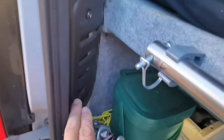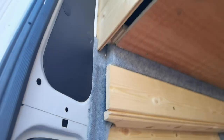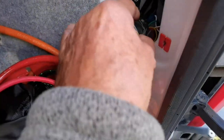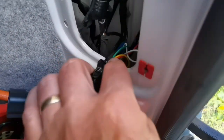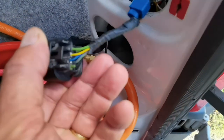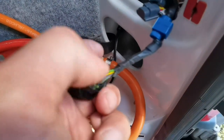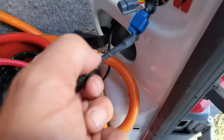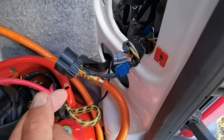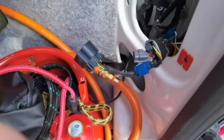What I did then was take a red wire - which you can see in there, I've not tightened them up yet - and it goes all the way over the top and down here, then plugs into the wiring loom here. You find out which wire it is, look at the color code on the back of the plug, and correspondingly put one of these blue clips on that wire, connect your towing hitch wire to that clip, crimp it, and test it.